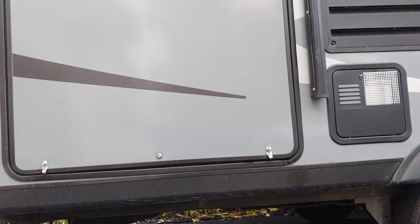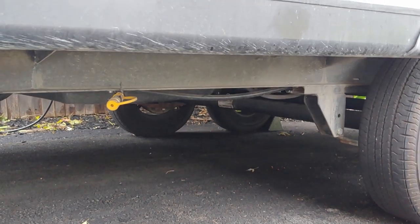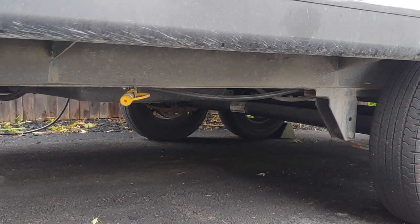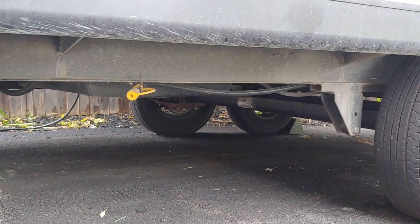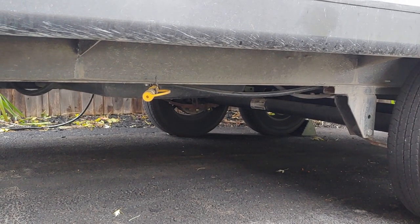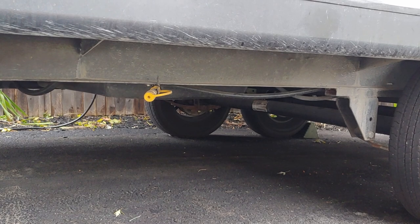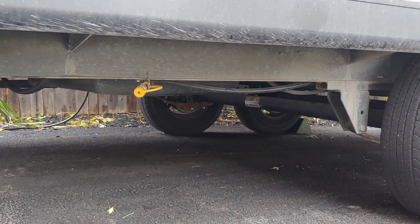Here we are right at the outside kitchen. It really was an easy project — I think it took about five minutes to install. I needed a wrench to remove the original cap, a wrench to install the new hose back here, and a couple of wrenches to install the adapters. You'll need thread sealant up at the regulator or splitter, but these fittings are all flare fittings, so just crank them down — they do not need sealant.